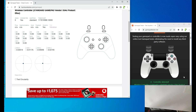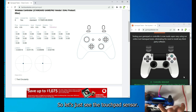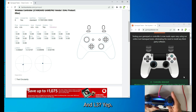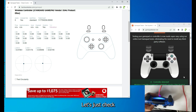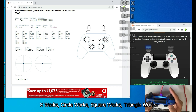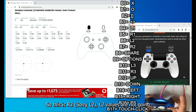This is another controller with problems: L3 skips and the touchpad sensor doesn't work. Confirming: touchpad sensor has no input. L3 skips — even with a very hard press it sometimes works, but it randomly skips. Other buttons are fine: X, Circle, Square, Triangle all work.